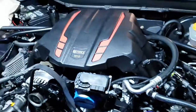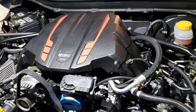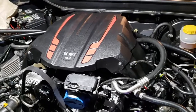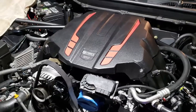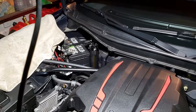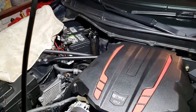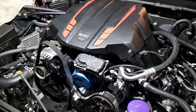And I disconnected that 2 years ago. So for 3.5 years of this car's life, it was sucking in oil, and it coated the whole intake just from that. And these boxers don't have much blow-by. I never filled that can the whole time I had it. I had it on there for at least 2 years, maybe 3. Never filled it. It had like 2 or 3 ounces in it after that whole time. So that's not a lot. And it still coated the whole intake.